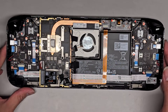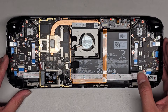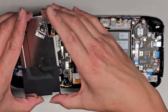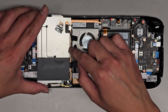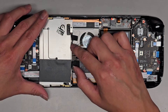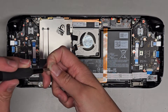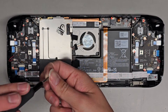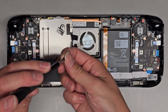I'm not going to be taking the whole thing apart again. The whole point of this was to upgrade the SSD and then kind of show a close up inside. Let's go ahead and make sure to put all of this back in. This piece — you want to tuck it underneath the fan cable here. So we'll slide that underneath and then we'll lower this down. Let's go ahead now and tighten back the screws. I'm going to loosely fit this screw first and then get the other one to make sure everything's lined up, and then we'll get this one in the middle.